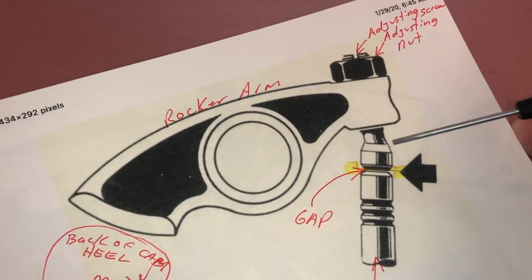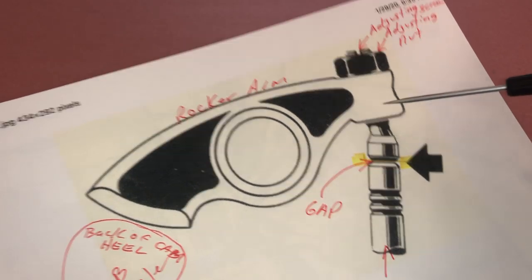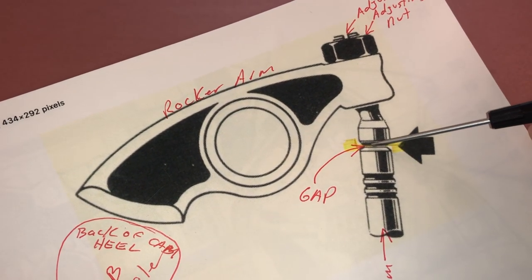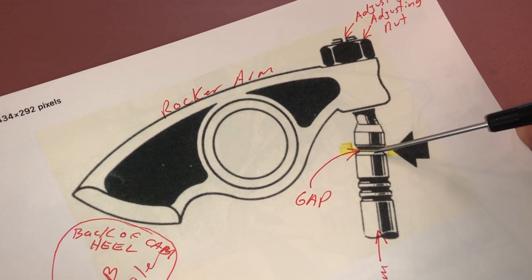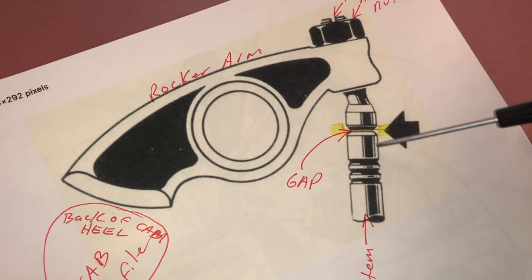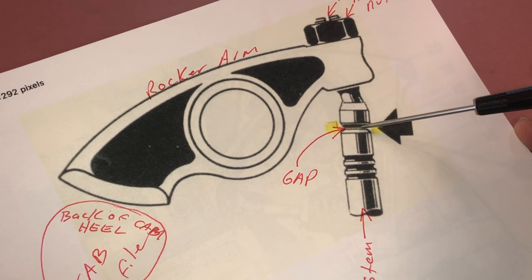Lastly, why do we have valve lash at all? The reason they put valve lash in here is really to provide for two things: one is thermal expansion in the engine, and the other — and the main reason — is lubrication. When your engine has one rotation, this rocker moves up and down on your valve stem. Once it lifts off when we're on the heel of the cam, that allows oil to pass through and lubricate the top of your valve. It also creates a cushion as the rocker comes back down and hits that film of oil before making contact with the valve stem. Without any space in there, you'd have steel on steel, premature wear of your valve train, and eventually a crashed engine. The spec on this valve lash is very important because it affects your cam timing — if we're too wide, your cam timing is going to be late; if we're too tight, it's going to be too early.